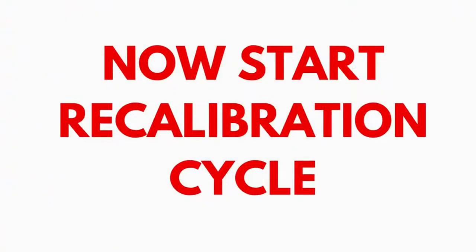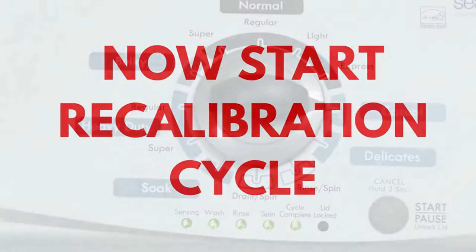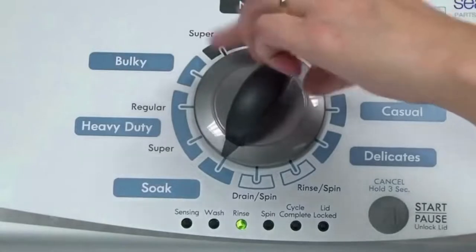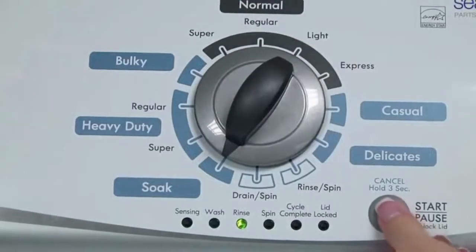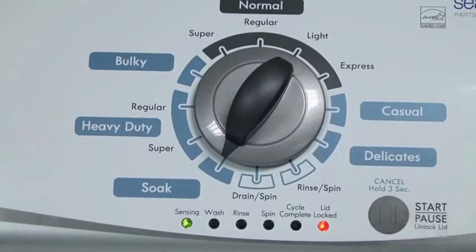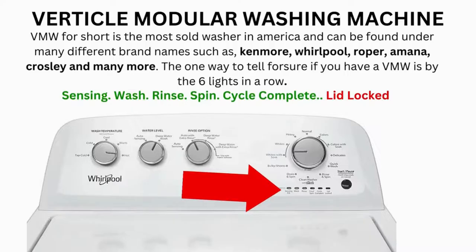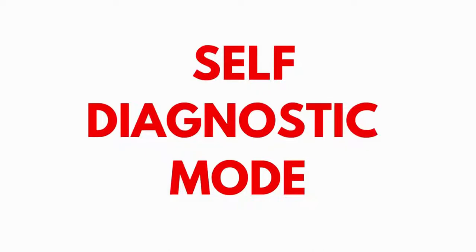In the diagnostic mode, with all lights flashing, select the calibration cycle by turning the control dial 4 clicks clockwise, or 4 clicks right. When you're on the correct setting, the rinse light turns on; then simply press start. It begins the calibration cycle, which runs for 2–3 minutes as it checks all the cycles and functions on your machine. When the calibration cycle ends, if all goes well, the lid unlocks and the washer shuts off. Try your washer to see if that solved your issues; if not, continue to the error code video. If after 20 tries your arm feels like it's going to fall off, odds are you have a bad control board. If your washer starts the recalibration but doesn't finish it, you need to pull the error codes and find out why.